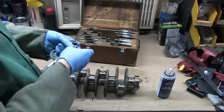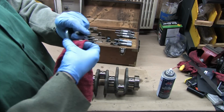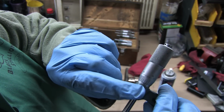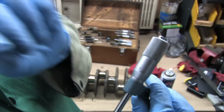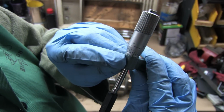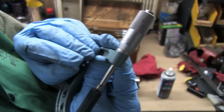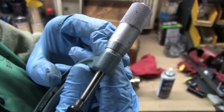These are a really nice set of old school Mitutoyo 10,000th micrometers. I don't deserve this, but I sure did need it. Big thanks, Chad. In order to ensure the accuracy of your measurements and prevent damaging parts, both the tools and the parts need to be spotlessly clean. You should have all your micrometers and parts at room temperature, or at least the same temperature. Verify or set the 0 point using a known good reference before you begin taking measurements, and make sure you have all of the 0 marks lined up. There's actually 2 of them on the 10,000th spot.